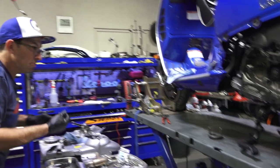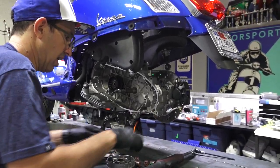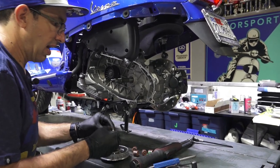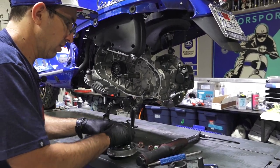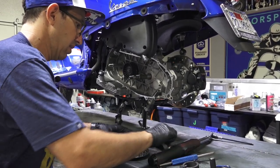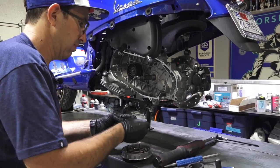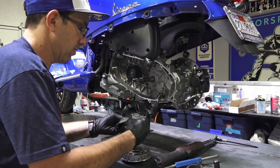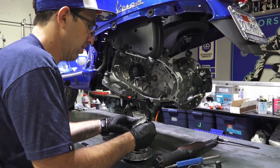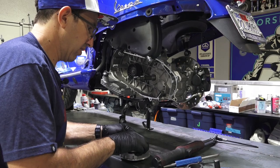And again, this is all repeat information. If you watch the other videos, not going to talk about much, but open clockwise for these rollers. Already checked these rollers. They're used, but they're still in serviceable condition. No issues there. These little guides only go one direction. They are still in decent enough shape. Drop this on. The variator is, of course, in good shape.